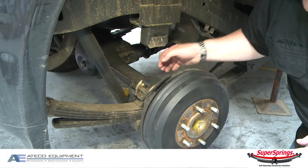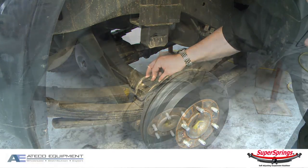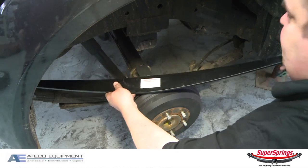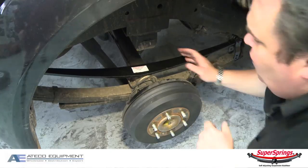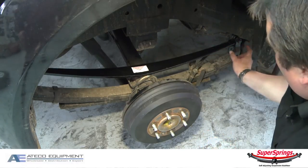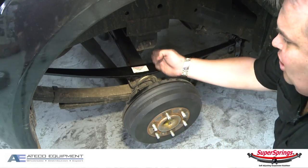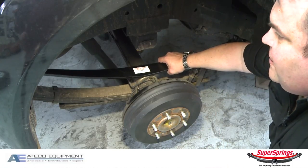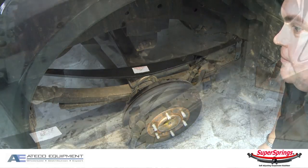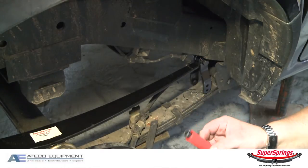Once that's in position, the spring goes on top — that's not going to move at all anyway because it's under load. We need to now position the Super Spring inside the wheel arch. What you want to do is position it centrally so that your gap between this end and the other end is equal. Don't worry so much about where the centre line of your diff is going to be, because you're mounting this to get an even balance. Now that we've got the Super Spring in position, you want to have your shackle, pin, and bush all sitting here ready to go.